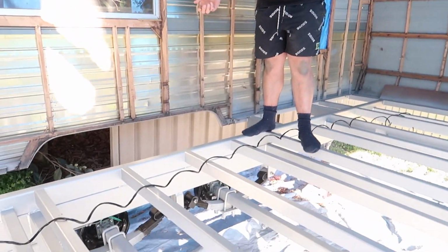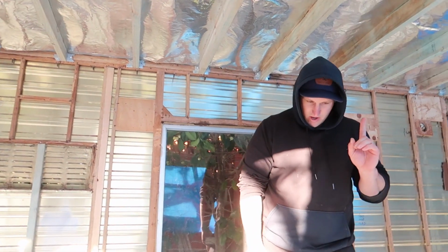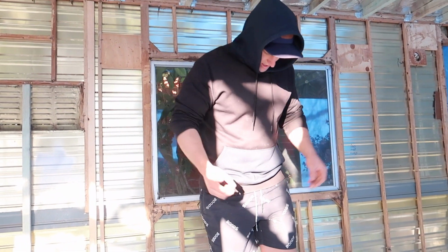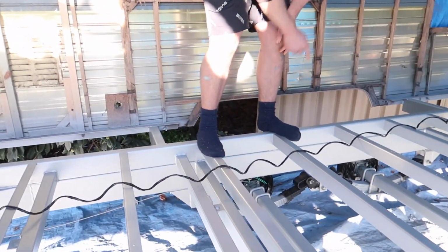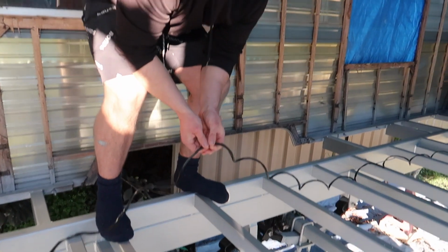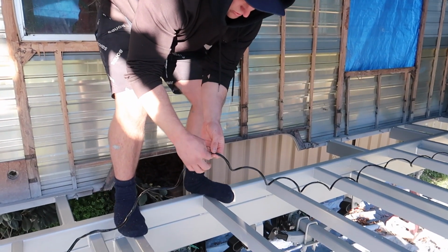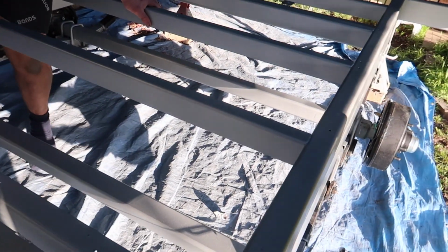So what have you got to do now? You have to strip it, is that right? Yeah, so I've got some other wire. It's just 2-core, so that's 7-core, like I said. I've got some 2-core. And then, so brakes. I will cut into it here. Find my blue and my white, because blue is my brakes and white is earth. And then I'll just solder onto the blue and the white and run a cable down to these.